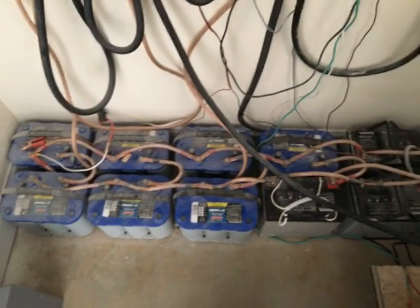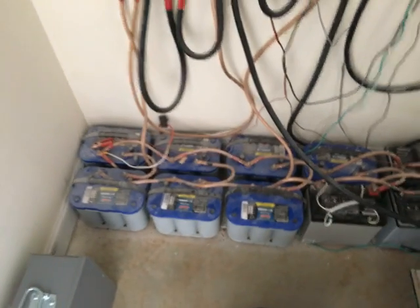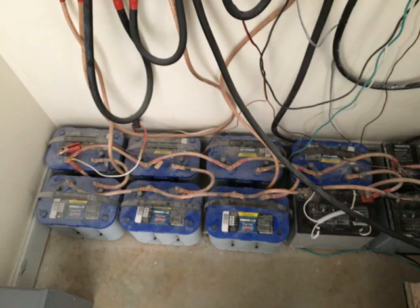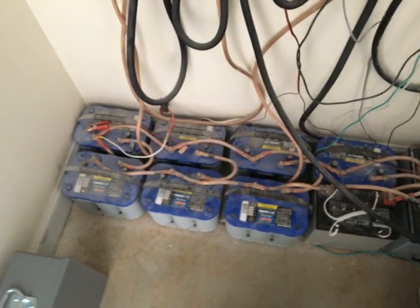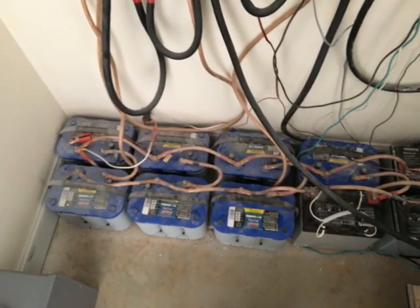These batteries are old, but guess what? They are good batteries. And for the most part, these Optimas, if they are kept in a float state, should keep for 7 to 10 years. And these other batteries, they're AGMs, and again, they keep a charge, and they work fine. Now, don't get me wrong, I'm not saying to mix and match haphazardly, no. What I'm saying is, if the batteries are within the same age, and generally the same condition, and quite frankly, used for the same purposes, they should be fine. Again, this is just my opinion based on my experience.